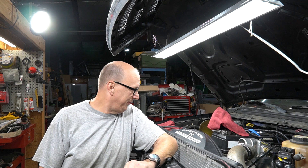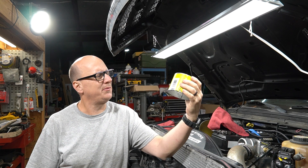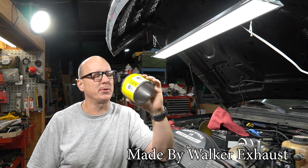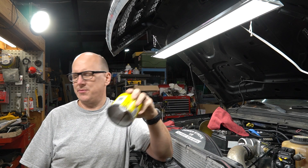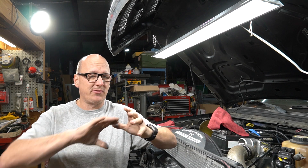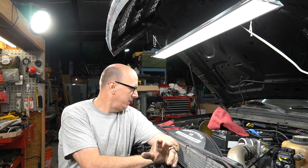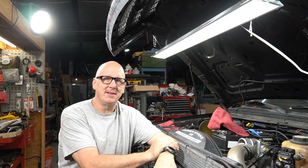As you can see it actually fits pretty well — I'm pleased with the way it turned out. The elbow I ended up using is a 4-inch, part number 4-1474; I can't remember who made it but I'll try to find it and put a link in the description. It's a four-inch radius instead of the typical six-and-a-half to eight-inch radius, so it's a tighter, more compact elbow. I still have to come up with some kind of mount for the mass airflow sensors — both the Cummins and the Ford — but we'll get those in next.